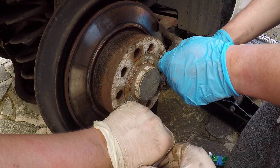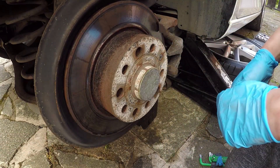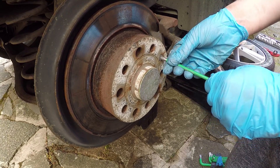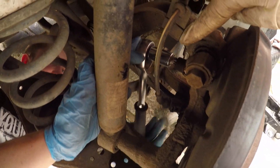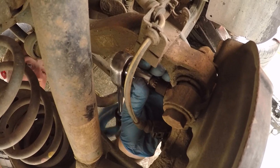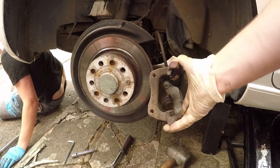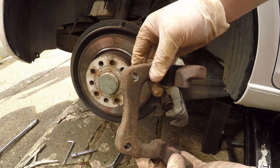So we're just going to take the disc mount screw off now. Then we're doing the caliper anchor bolts — there's two on the rear. One as you can see where the socket is, and one directly below it. They're both exactly the same size — 14 mil. And then it'll release the caliper holder there. Those two bolts have been loosened — simple as that, very simple, not hard at all.